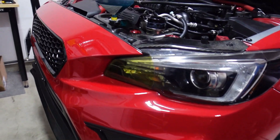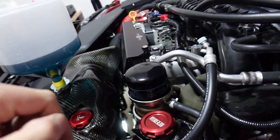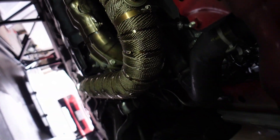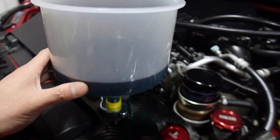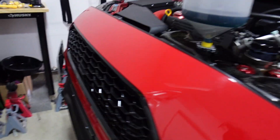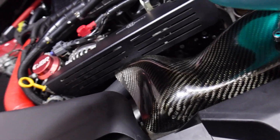It's been about 15 minutes. There was a little smoke coming from the turbo area but I think that's just from the new heat wrap I installed — that's pretty normal while the wrap breaks in. So far no leaks and it's still idling normally, which is a good sign. I'm waiting for any last-minute bubbles before dropping the car. There are a couple questionable coolant spots, but I think it was just from the bubbles blowing out and spilling down — it had to have come from the bleeder.